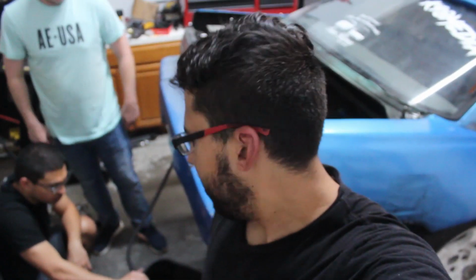Thank you. So the reason we're taking the gas out is because when they were turning the fire off, they actually sprayed that sandy, foamy thing. It was different extinguishers. Each one is different. But they sprayed it and the cap was missing, so a lot of it went inside the fuel cell. There's all kinds of people. Some people told me you'll be all right. You have a filter for a reason. But then most people told me, take all the gas out, throw it away, put new gas, or clean your fuel cell and put new gas. So that's what I'm gonna do. It's only like half a tank that was in there, not a big deal. We're just gonna drain it, take the bladder out, open it up, and let it breathe overnight.